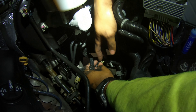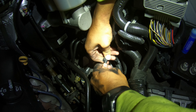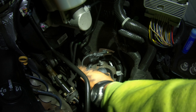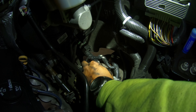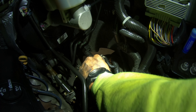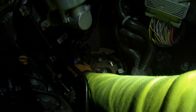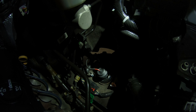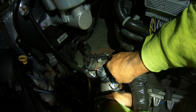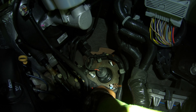Back up top — first thing you want to do is plug this connector back in. Click it back in like so, push that gray tab back in — it's locked back in. Make sure that's covered up. I'm gonna run a little bead of blue Loctite on all these studs here and then tighten up the top, and we'll holler back at y'all in a second.